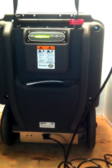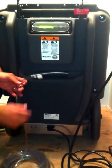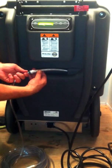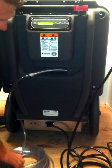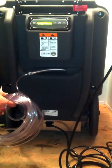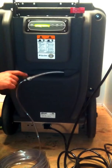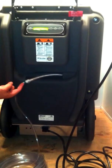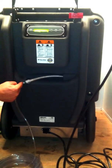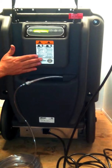The second thing that you need to plug in is this 40 feet of clear hose. Because it automatically purges every six minutes, you simply plug this into the receptacle and run your hose into a toilet, a bathroom, a sink, or out the door. You can run this hose no higher than 20 feet from where this machine is — the exit of the hose cannot be 20 feet higher than the machine. However, if you go up a set of stairs from a basement, you're okay. This machine will handle it.